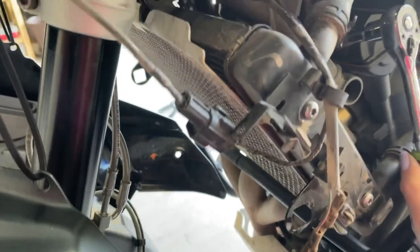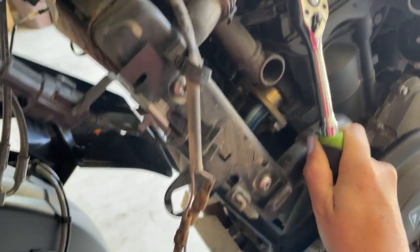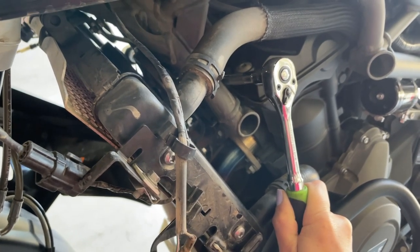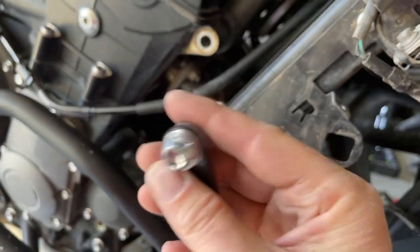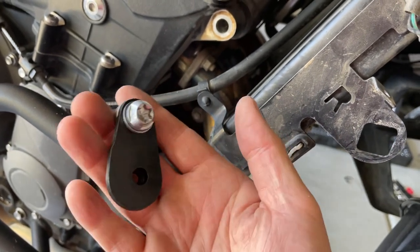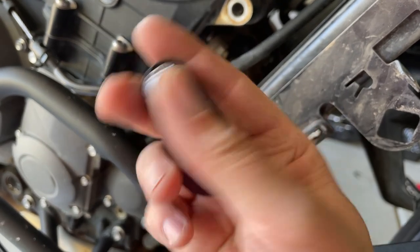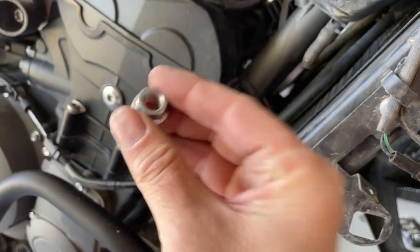On this side you're probably going to need some help from somebody to hold the nut from the other side of the bike. You're going to need a 14 millimeter socket to hold the nut. You just need a long extension to get in from the other side. Now we need to fix the upper bracket — you have a thick spacer washer, then the actual bracket, then a washer and a new fixing bolt, and the lock nut goes on the other side. You'll need the T50 Torx and the 14 millimeter for the lock nut on the back.